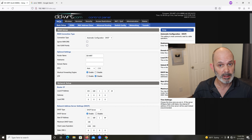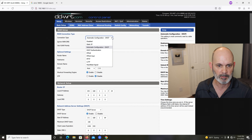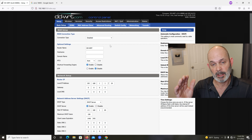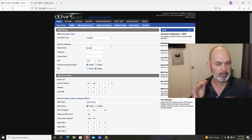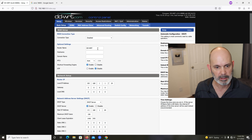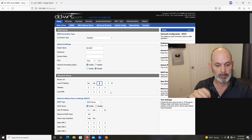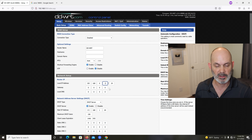We're back in and we didn't have to re-log in — it caches your credentials. This is DD-WRT and you can see it's pretty robust with a lot of options, but it doesn't really matter here. We're just going to set up the router as a switch. It will be a five-port switch instead of a four-port switch — the internet WAN port will be usable as a LAN port. Let's go to the Setup tab, go to Basic, and we're going to go here to Disabled.